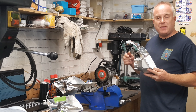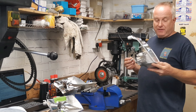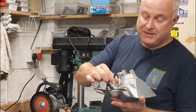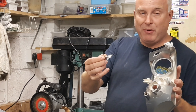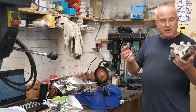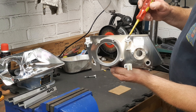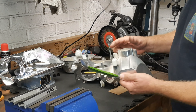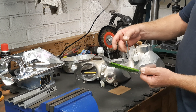In today's video in our series about custom headlight builds, I'm going to effect some headlight reflector refurbishment. Bosses in the reflector system that hold the projector into place get easily broken if the light has been knocked. Today I'm going to show you how I'm repairing this. This reflector also has a broken adjuster socket and I shall swap that over. I shall also move on to make some new studs for mounting the projectors on.